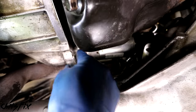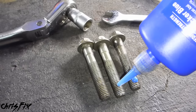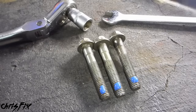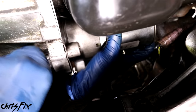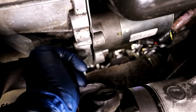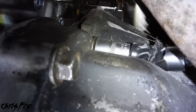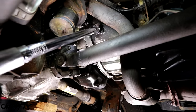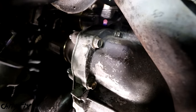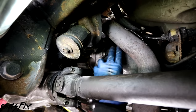Now we can bolt in the starter. Spin it around, push it in, and line up the bolt holes. We want to use some removable thread locker on the three bolts - thread locker not only prevents the bolts from loosening due to vibrations, but it also coats the threads which helps prevent corrosion. Start with the easiest bolt, the bottom one, and start threading it in by hand. Tighten it most of the way but leave it loose enough to align the other two bolts. Tighten the middle bolt next using the swivel ratchet in these tight spaces. Finally, use the universal joint and extension for the last and hardest to reach bolt, and tighten it down completely to 20 foot-pounds. Now torque down the other two bolts as well. All three bolts are torqued, the wires are connected, and the starter is completely in. It all depends on where your starter is - having the right tools makes the job go that much easier.